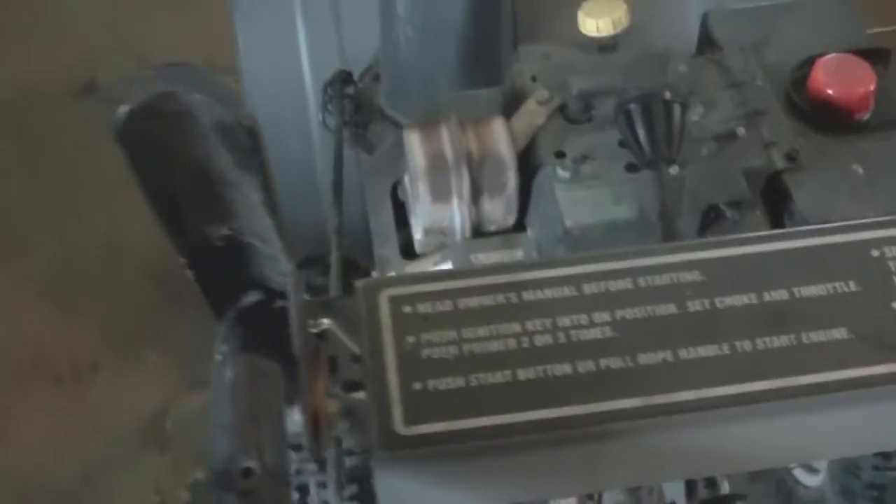See the nuts here - this is actually an adjuster. Mine's a little long; I think I've got something that needs lubricated up in the front because I can get them totally loose. You can unscrew this and get the bar out. That bar goes right into this hole. While the handle's down, take that bar out, feed it to that hole, bring it down, and screw the cable back on. Then do your adjustments. You want this snug but not too tight. Mine's loose, and I know it is. I think I've got a worn spring in the bottom - I'll have to change that later, but it does seem to engage the clutch.